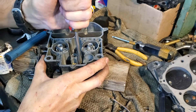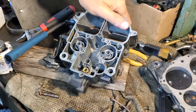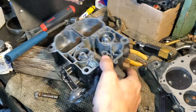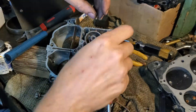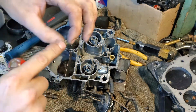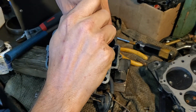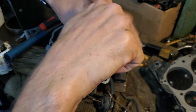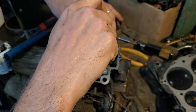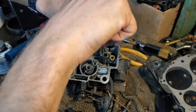Make sure you don't strip anything and don't go crazy tight. Now for the two jets — these are 70s. I'll have to look and see what the primary rods are and I'll try to put them in the description. Make sure these have been cleaned — you can use that same tool. Once they seat down just give it a little tight twist; don't completely tighten these, they are not going to go anywhere.